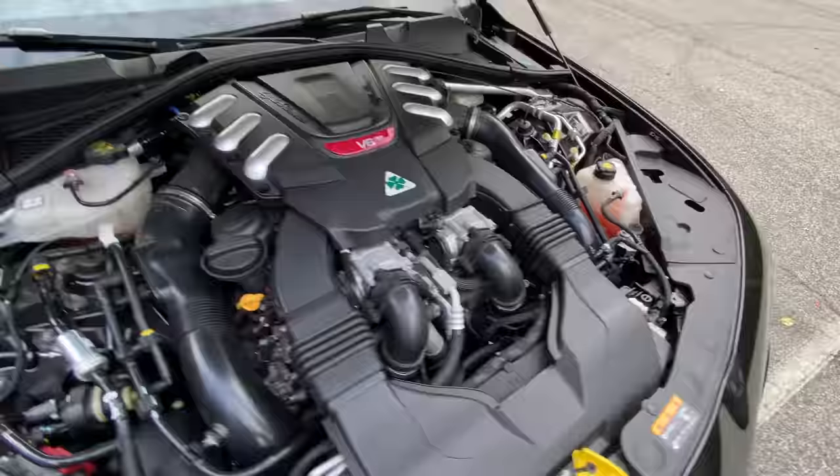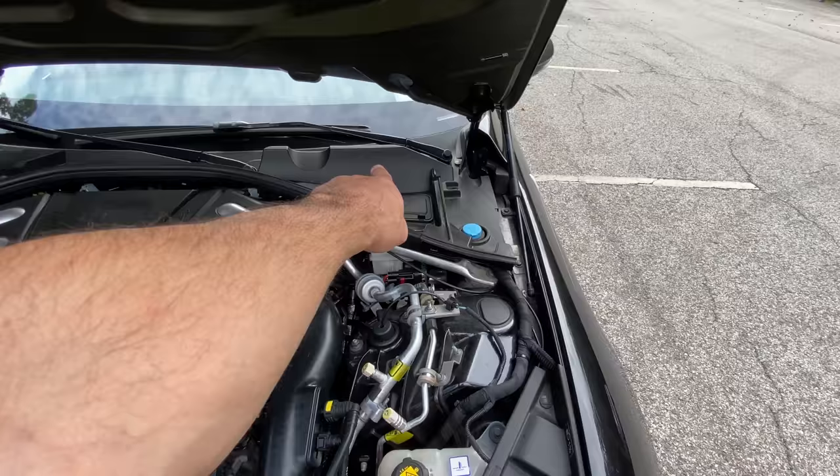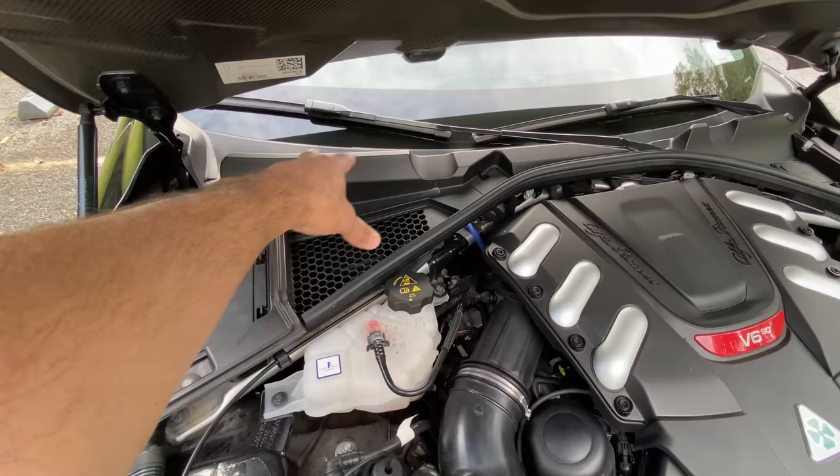So there was a wiring harness that goes to the headlamps and it goes to the back of the dash. It's actually connected to the instrument panel and somewhere at the cowl area over there. Now, of course, you remember the cowl was all taken apart to fix the water intrusion problem that I had where the HVAC system lies right over here. Apparently, the first time around, they didn't seal it right and they didn't do it properly. So that had to get done over again.